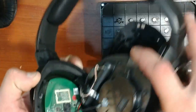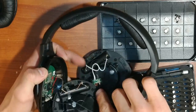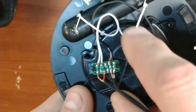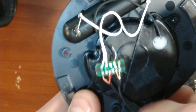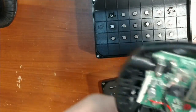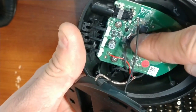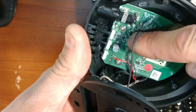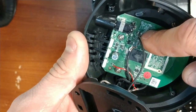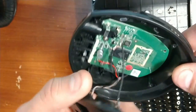Inside you can see the wires coming from the speakers on both sides. On this side the speaker wire comes from a little blue wire, which goes to the white wire on the other side. On the circuit board side, which is the right side, you can read descriptions on the circuit board that say right positive, left positive, right negative, and left negative — so you can find out where we need to attach.